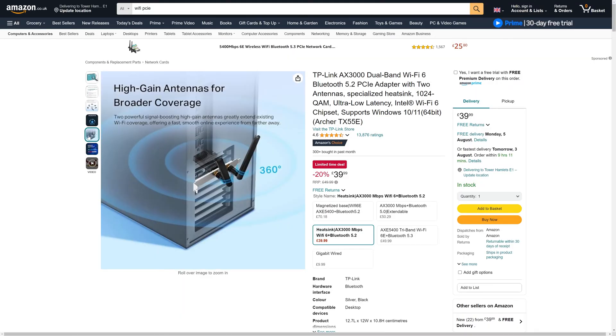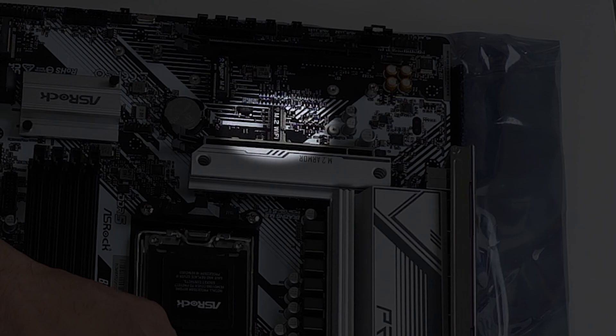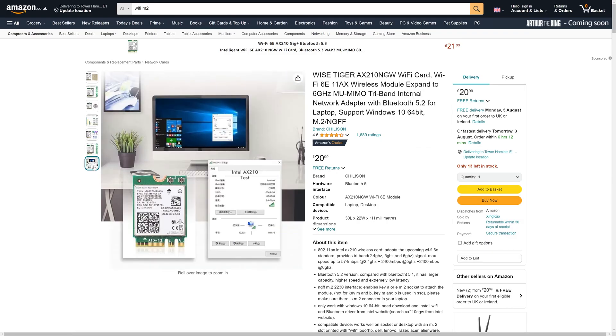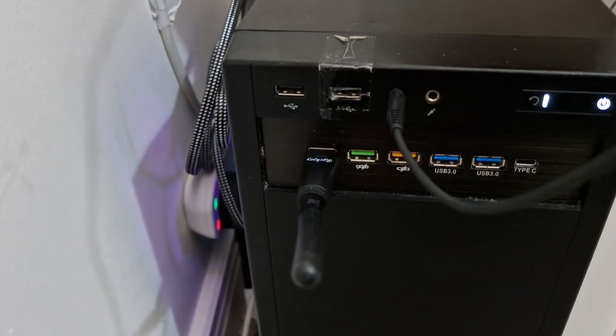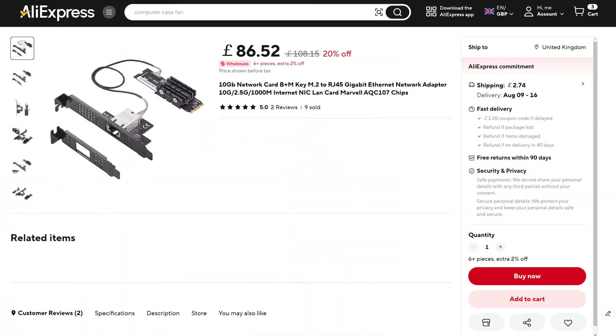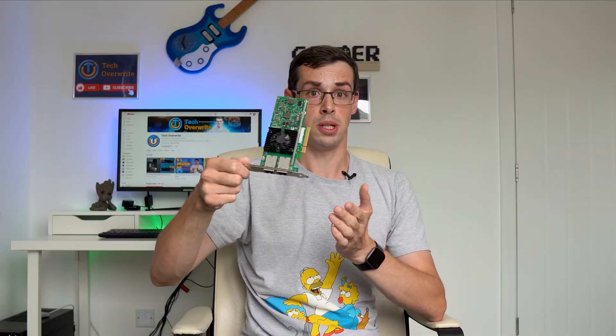The sixth option is to just give up — kidding, sort of. If the other PCIe card you wanted to install was something like a Wi-Fi card, there are other options. Some motherboards have an M.2 slot specifically designed for Wi-Fi cards, so you can simply buy an M.2 Wi-Fi card and fit it there. Alternatively, you could buy a USB Wi-Fi adapter — while these aren't always the most reliable, they can sometimes work well and it's a lot easier than battling with covered PCIe slots. Obviously this depends on what device you're trying to install. In my case, I had a 10 gigabit networking card with no real alternative — an M.2 to RJ45 adapter would be niche and expensive, so a riser cable was easier and cheaper.